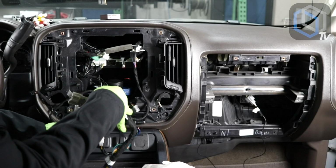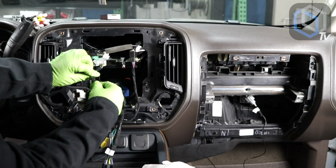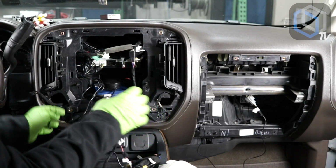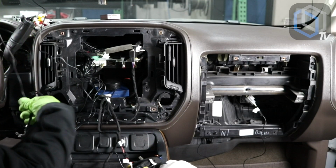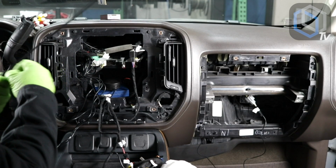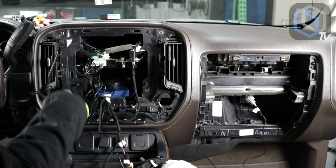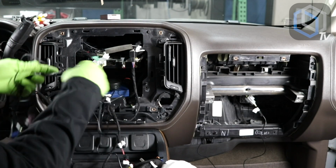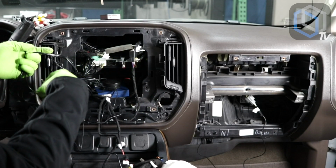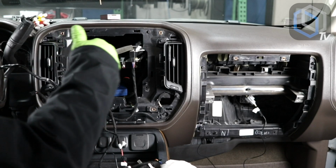And so we now have our steering wheel control plug right over here, just like this. Now my microphone is going to become part of the antenna connectors, just so that once I'm plugging one in, I'm plugging them all in. Remember, this one's plugging into a different harness, so you could give it the same slack, you could give it less. It's really up to you. So now we have our microphone and all of our antennas here.